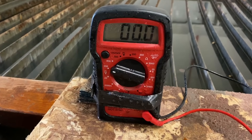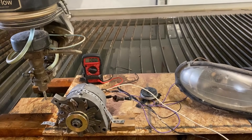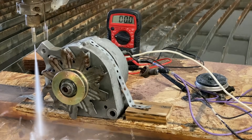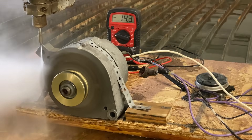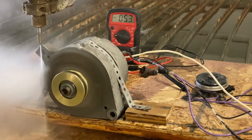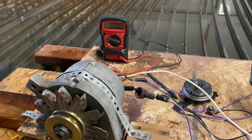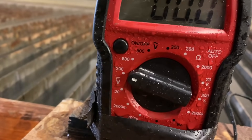So we've got the alternator turned up now to the next high setting so that we can read a higher voltage. We're out of headlights, but let's just see what kind of voltage that shows. Initially, it just spikes straight up to just over 20 volts, which is why the meter was maxing out on the other setting — which blows the headlights.